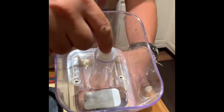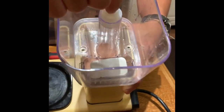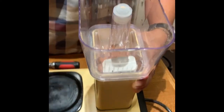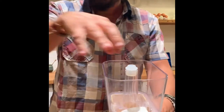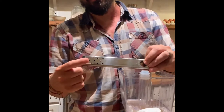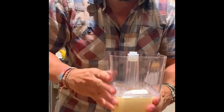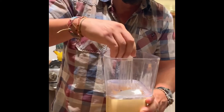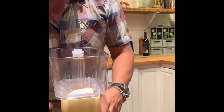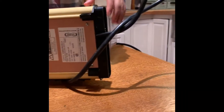At this point, pull the reservoir up. There's a glass tube that goes into the reservoir and connects with a fitting attached to the heating element. All the hot water rises through that glass tube and out into your coffee. Just pull it up and you'll feel it come off the fitting, though a rubber hose is still holding it together.